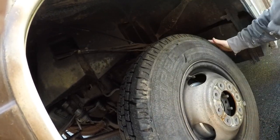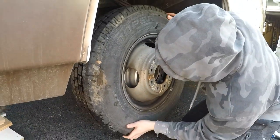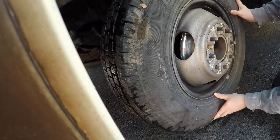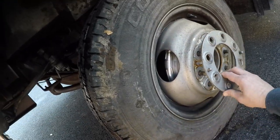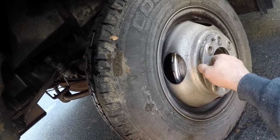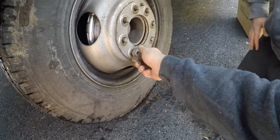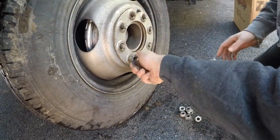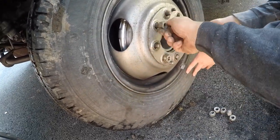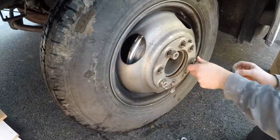See how that slides right on. Now it's as simple as putting the tire back on. Before we do that, make sure it's not bumping into the caliper — it doesn't look like it. Nothing is touching, and the hub isn't sticking out enough to cause interference. This is laying really flat. Now we put the ring back on, get some nuts hand-tightened, and you can actually see the balancer right inside the hub, which is cool.